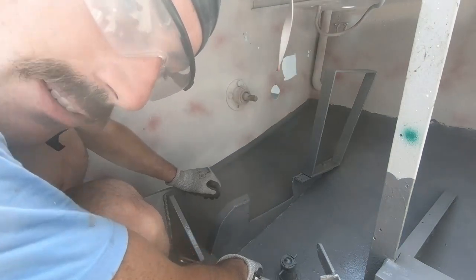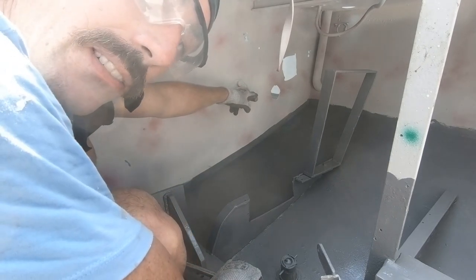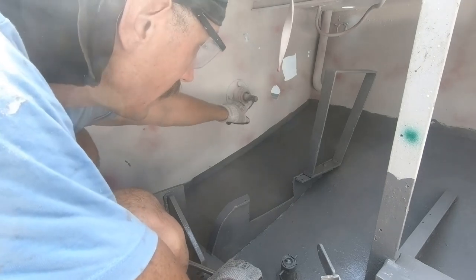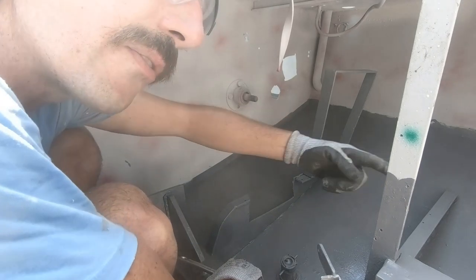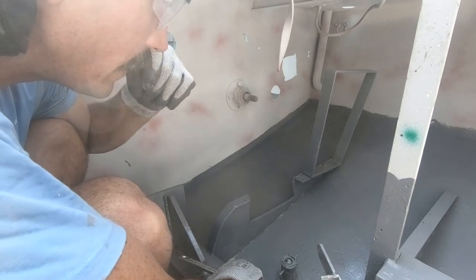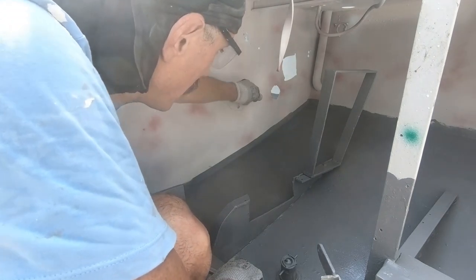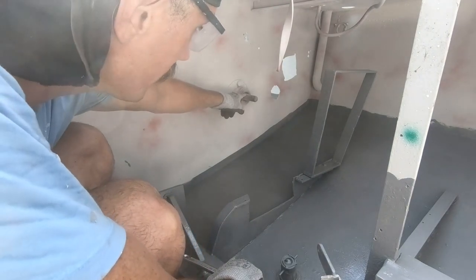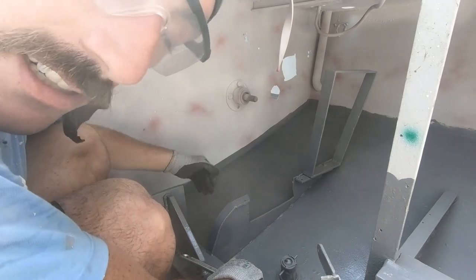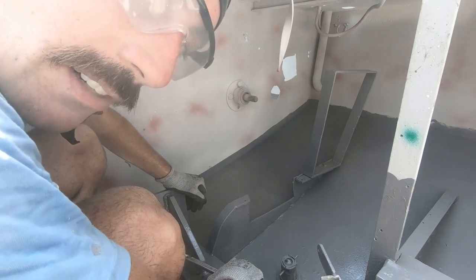Another thing I should have done in the right order. This is part of the steering system. A shaft mates onto this spline and goes forward to the steering station. And all it does is pass the rotation through some bearings. And there's another one of these on the other side of this bulkhead, and another shaft attaches onto that just to get the steering through the bulkhead.